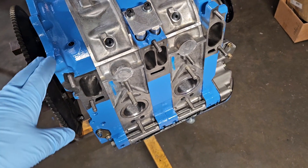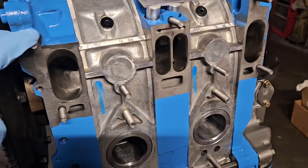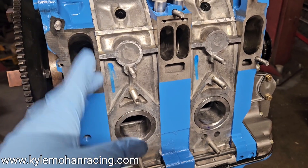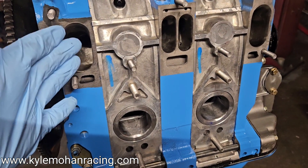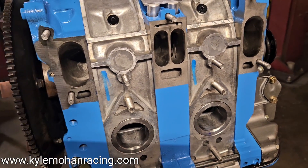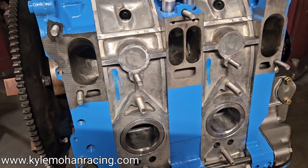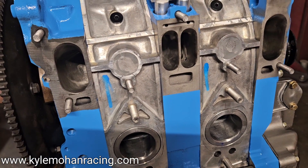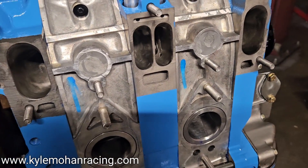Performance-wise, the modern castings are a great casting — they're strong, the port shape is already larger. We've got more volume on the intake, and the casting behind that intake volume also allows for aggressive porting. Whether it's opening up the duration and volume, street porting, or bridge porting, you've got a lot of material to work with and the runner characteristics are fairly good. This type of port design will flow more volume than the traditional four-port, but has better port shape than the later model six-port designs, which do flow more air but don't have inherently a good runner shape or runner dynamic.